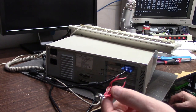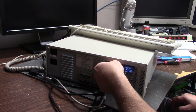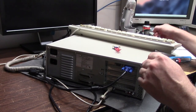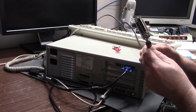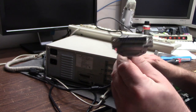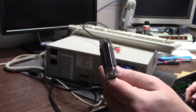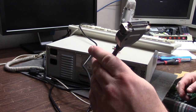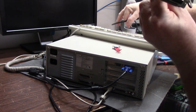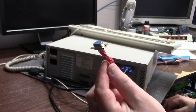I'm going to show you the pinout that I have to make because the Spectrum has a goofy one. And this sucker will just fit right in here. And I have a plastic housing that I'm going to hot glue like everything into. So I have an actual DB23 to VGA. It's unbuffered. So I figured this is a perfect candidate. Now this is a 25 that was sliced in the middle. So it actually still looks like a 23. Great. It's got metal on both ends. And it'll be working perfect. It's a little long, but it's got a VGA on the other end. And we're going to cut that off. And I'm going to use the housing and solder this thing in.